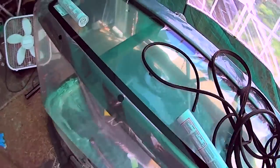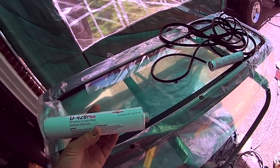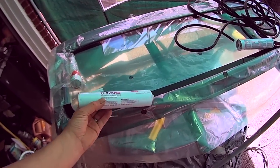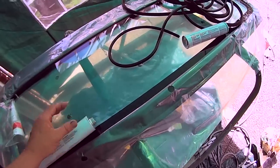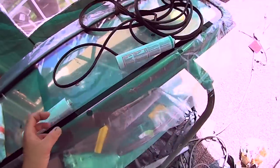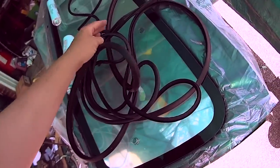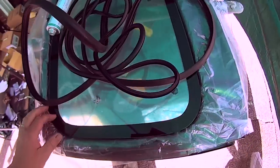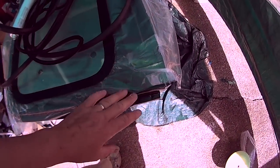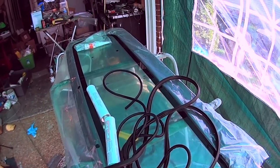These are the required components to installing the windshield on a YJ. We've got urethane glass adhesive, and this is primer to go around the glass for the pinch weld. We've got the rubber gasket for the inside and the outside. New glass. And our frame is brand new, so there's no old gook that we have to deal with — it's a brand new installation. So with that, I'm going to go ahead and get started getting it prepped.